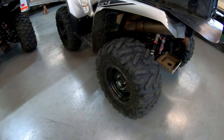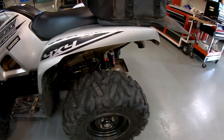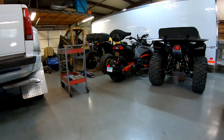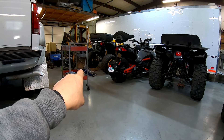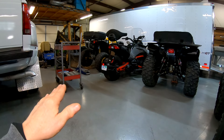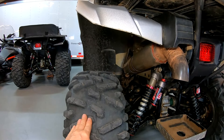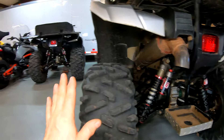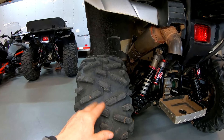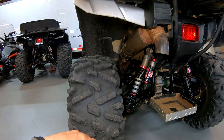Another thing I like about them - I run four and a half PSI in the rears and I think five in the fronts. I do like the profile; they have a pretty flat profile across the tire, not roundish like the Can-Am factory tires over there. Most tires that come stock on your machine are rounded. There is such a plethora of tires to choose from - so many manufacturers, so many different models - it can be super confusing.